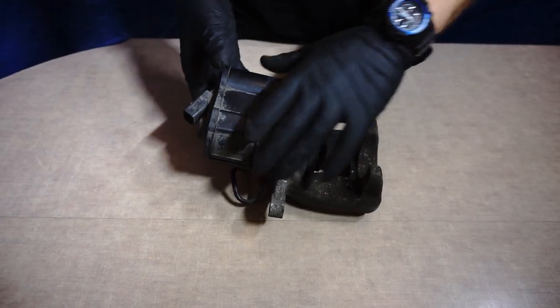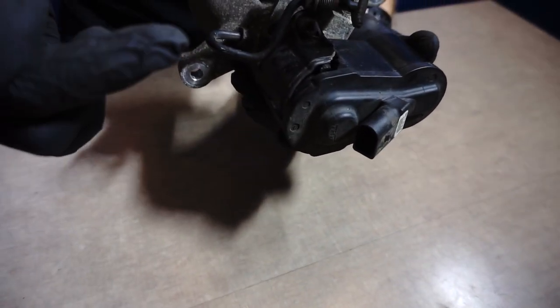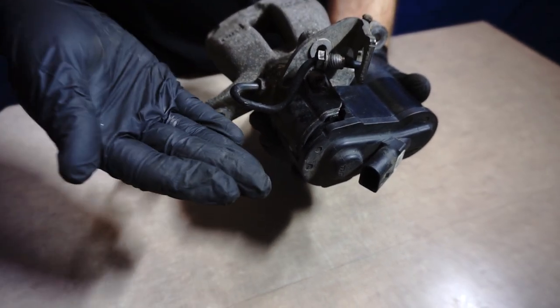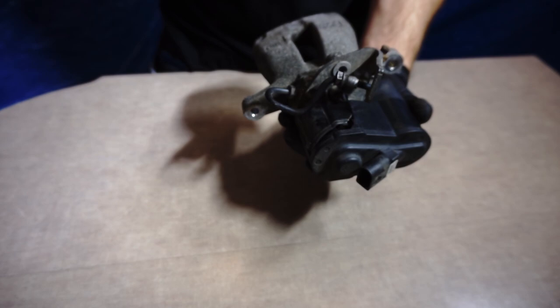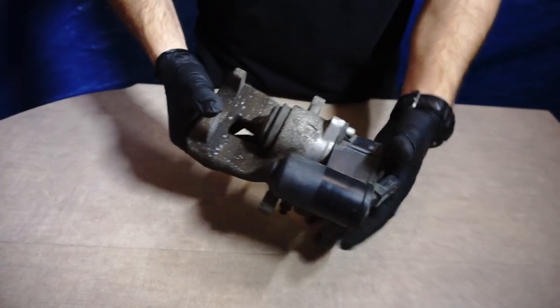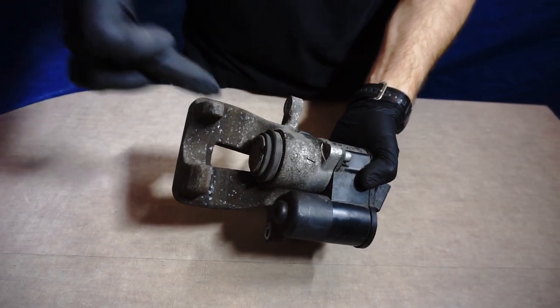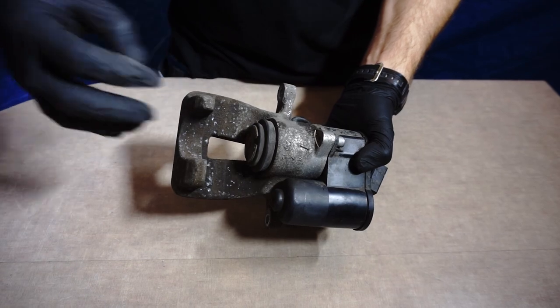In the event that the EPB mechanism is blocked or for some reason the handbrake switch does not want to release it, we have three ways to unlock the handbrake. In this type of caliper, the first is diagnostic equipment, second, manually connecting the power to the servo motor and retracting it, third, unscrewing the servo motor and manually turning the shaft to retract it using a spanner. Here we will present the last two.